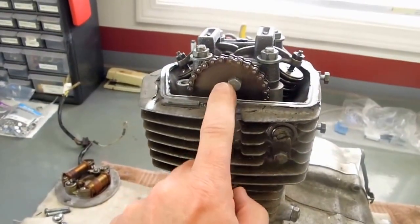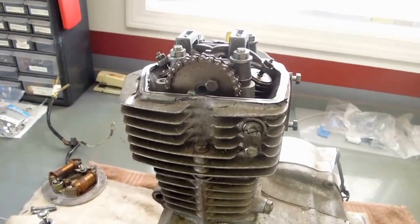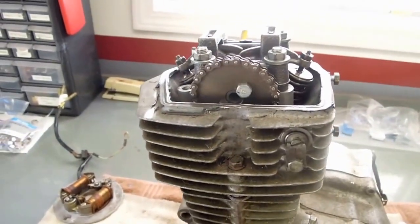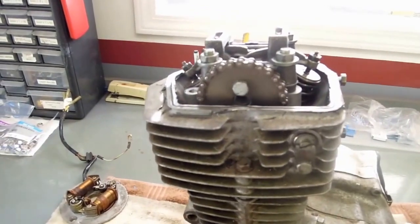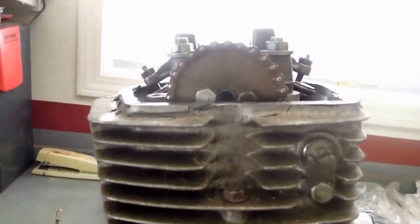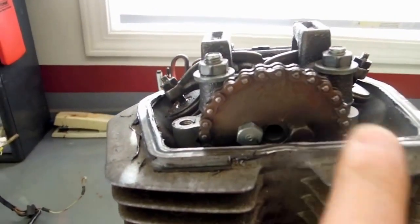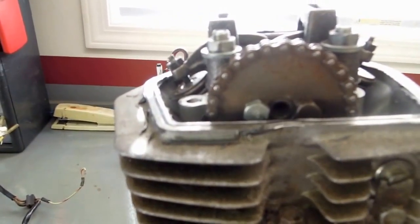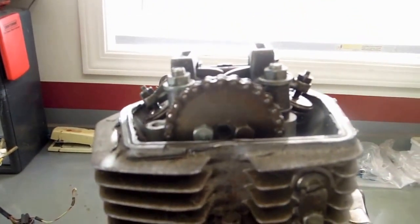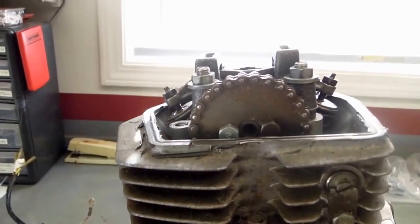You can see that bolt is not original — it's a different or new bolt compared to this one, as you can see there. My first thought when I look at these bolts and how I know the timing works, I think it's off at least one tooth on the valve timing of the chain. I suspect that, but I'm going to have to verify it. There's a mark right here, and when that's at the very top, these two bolts should be level. I suspect it might be off by a notch or two, so we'll get into that and figure it out.